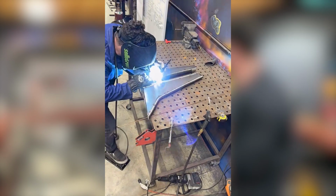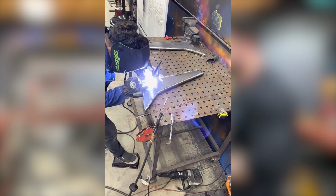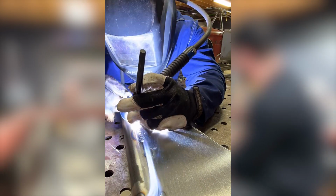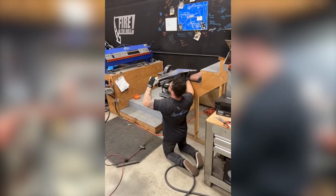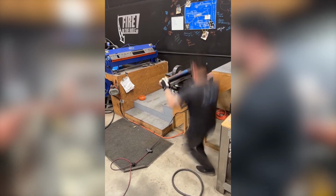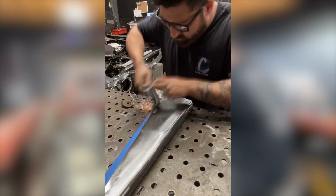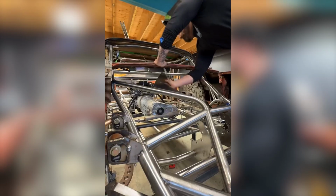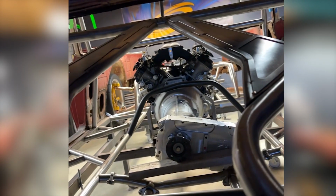So I started taking a crack at it, and I didn't want this car again to just be tubed. So what I did is I did a 1-inch bent tube, 1 5/8 in the back. I gave it this design. This is a support for my main structure here, which the push rod suspension will be based off of. And I really just filled it and blended it. There was a cool trick, which I'll show in a video later on, of how I actually did this. But for now, I just wanted to catch you up on some of the aesthetics of the build itself.